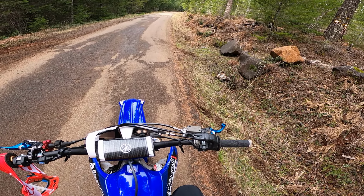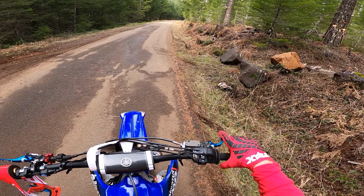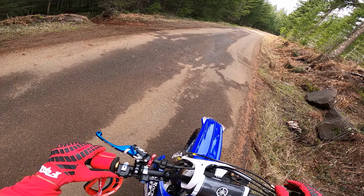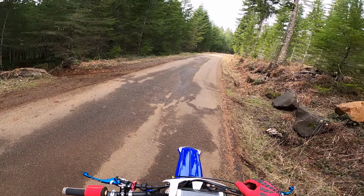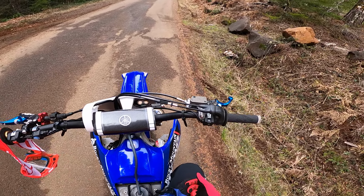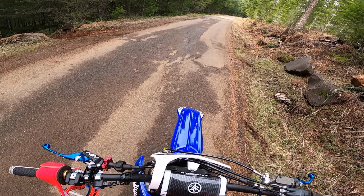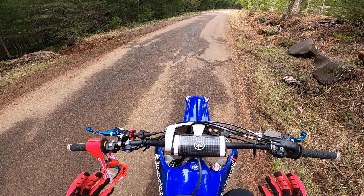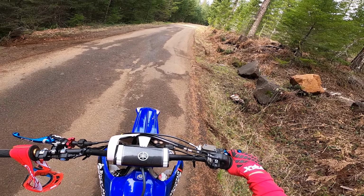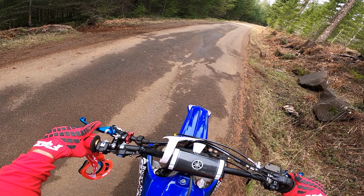So what I did to correct that, now you can see that, yes, it does have a little bit of sponge, but I put a steel braided brake line from Galfer, and I also put in a Galfer off-road enduro rotor, and it's still 270 millimeters, just like the factory was. It's not a night and day difference, but it's definitely more progressive. When you hit the brake pedal, you can actually lock up the tire a whole lot quicker than you could with the other one.